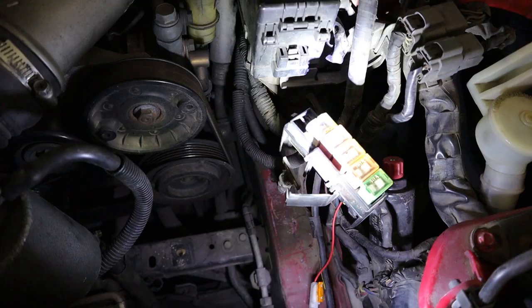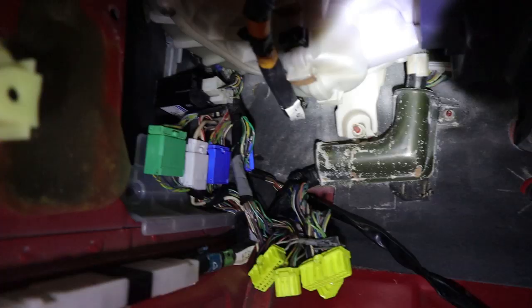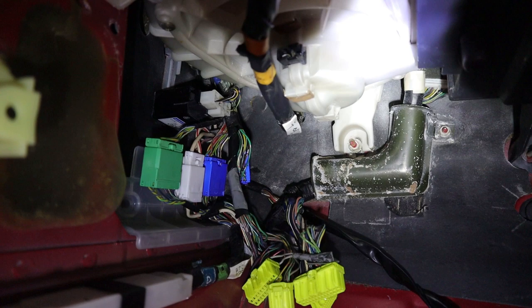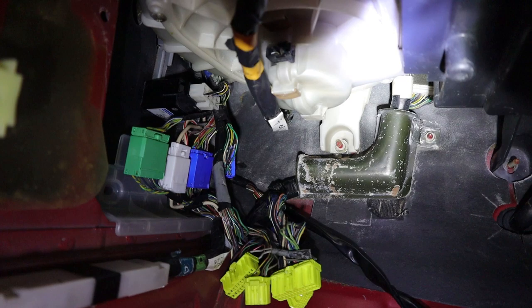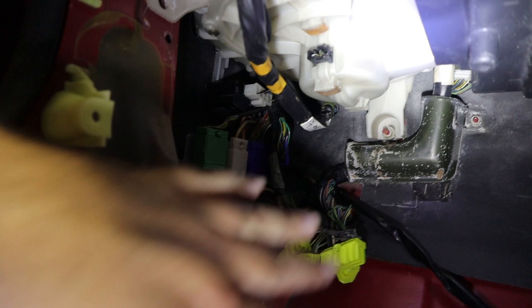The next step is to show you where that grommet is on the inside. It's difficult to see because it's covered up by a lot of the components behind the dash. This is the left hand side of the car - if we go under the very corner of where the dash meets the firewall, there's a little cutout in the insulation on the firewall, and behind that cutout is the grommet I showed you on the other side. The goal is to route the positive cable along the bottom of the floor pan and up straight into that area. On a right hand drive car I did go ahead and take the ECU out and clear out as many wiring harnesses and cables as I could, otherwise it would be difficult to feed this thick gauge wire through. I'll cut a little X in the grommet, just a bit smaller than the size of this cable, and then start feeding it through.